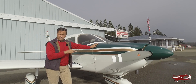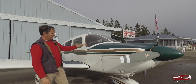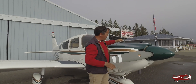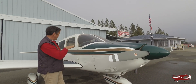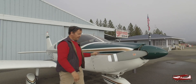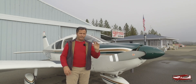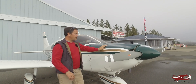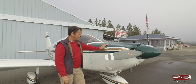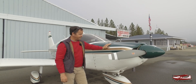This is a Cherokee 235, but to the casual observer this could very well be a Cherokee 180 as well because it's got this Archer cowling on it. The sides don't open — the whole top comes off. It's got this bulge over the top and it's fiberglass; the Warrior is metal. What makes it not be a Cherokee 180 at distance is the constant speed prop. The Cherokee 180 is an O-360, opposed 360 cubic inch. The Cherokee 235 — remember the number is horsepower — so this is an O-540, a six-cylinder 540 Lycoming with a constant speed prop. The exact same engine that's in a 182 RG.